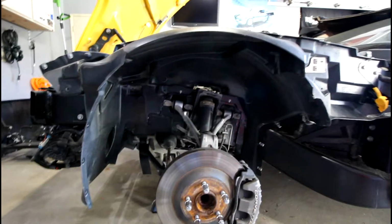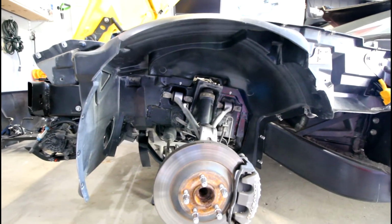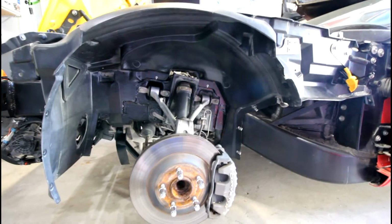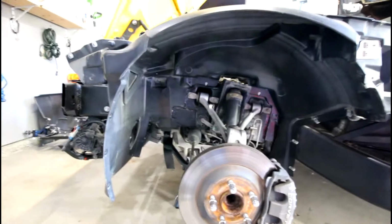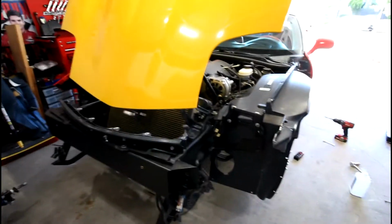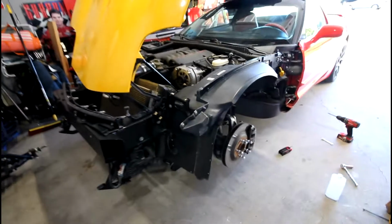And then what you're going to do is take your rubber gloves and spread that thin across all of the bare metal surfaces, because this is actually a corrosion inhibitor, so it's going to prevent any corrosion and rusting of the bare metal area. So that's why you're not painting over it again. So completely cover all of the bare metal first. And then I applied the glue directly to the fender in all the areas where I know there's glue. And I got that pretty nice and juiced up on there with lots of glue.